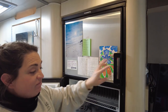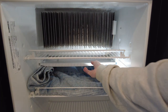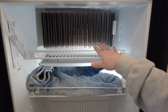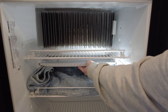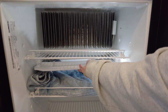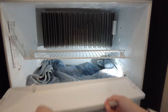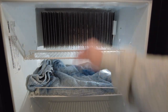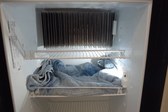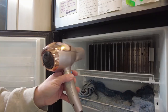The reason I do it in the microwave versus boiling water on the stove is that it actually helps clean the microwave afterwards — when you steam something in there it's super easy to wipe down. When the water comes out piping hot, I put it right in the freezer and close the door and let it do its thing. While that's working, I work on the fridge section. Put down a towel because things are already starting to melt. I remove the condensation catching tray because the drain hole is really small, and since we're doing this so fast it would actually flood your kitchen floor. Now the dripping goes right onto the towel, which is what you want.